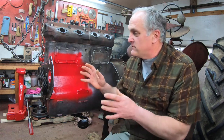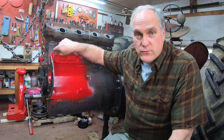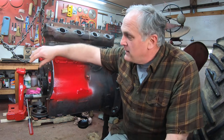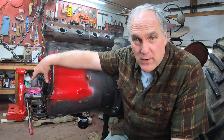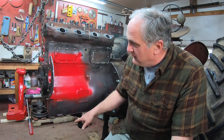What I thought I would do is, I'm going to be working on this again tomorrow. I've got another rainy day. I thought I would split this video in two and release it in two consecutive days, because the next day's work is a big deal. I'm going to install the injection pump, install the distributor drive on the other side, so I have the timing gear train all finished up. Then I can put on the timing cover. Before I do it, I'm going to do yet another check of the timing to make sure everything's timed properly. Then put on the oil pan, then finish the rocker arms and the valve cover.